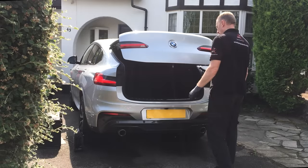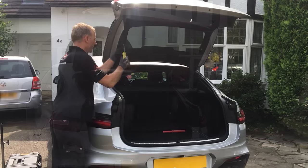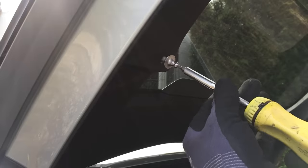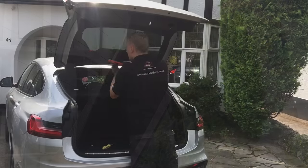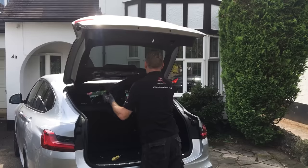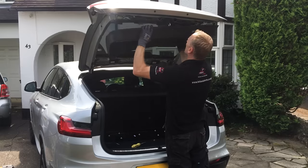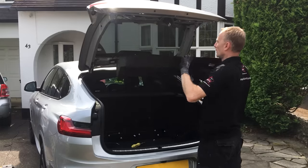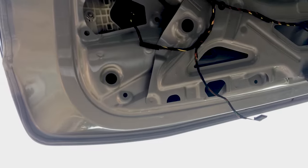As I've decided to go in from behind, I need to remove quite a few trims before I can take down the large main trim. First, I remove the switch for the boot closure, which pops out very easily. Next, I unclip the rear window trim, then remove two screws either side, followed by two screws hidden in the top recess at the base of the pillar trim. I can then unclip the rear central trim, which allows me to remove both pillar trims easily. Once removed, the large rear trim can be taken down by gently pulling it away from the tailgate and disconnecting the interior light wiring. Luckily, the gamble has paid off — we have lots of access points to thread the tools in behind and lever this damage out.